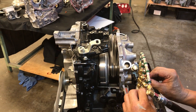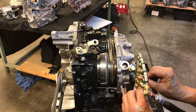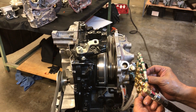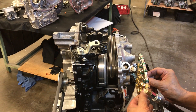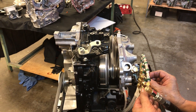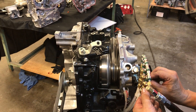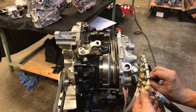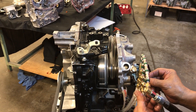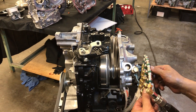Let's do that one more time. I'm going to bring up the primary a little bit more — you can see the belt ratio is changing. I'll let off and bring it back down again. The secondary just kicked in. By controlling these two, it's basically like the A-B switch of the valve body. Let's do it again — get a little more pressure on the A, here it comes, full ratio. Let off, and I let the pressure off so it returns. Keep in mind, on the secondary pulley, we have a big spring that's always returning it back.